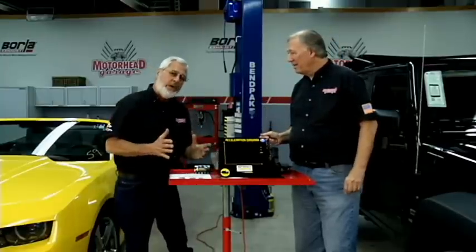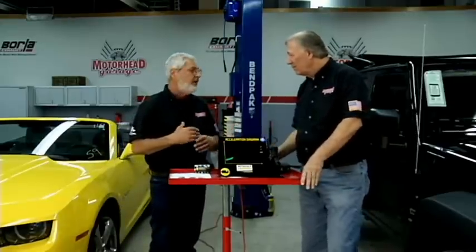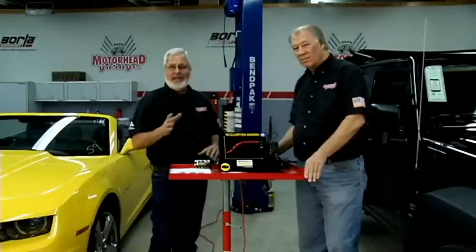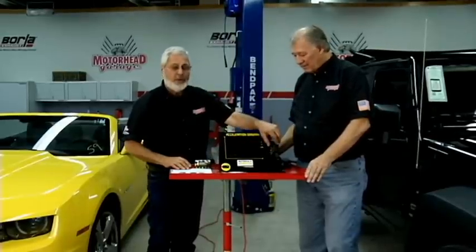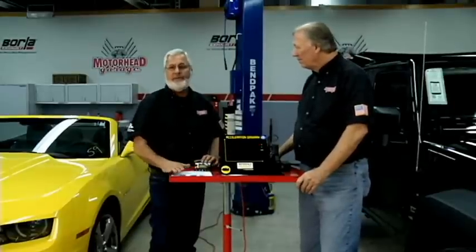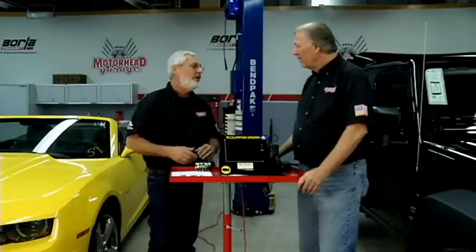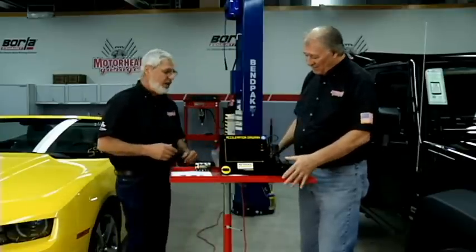Right. But it's a computer controlling how fast that throttle plate opens with a DC motor, an electric bidirectional motor. That gets a signal from the throttle position sensor, which is now mounted on the throttle pedal. You step down on it, and as hard and fast as you push it, it doesn't matter. The computer still does what it wants to do, and here's a great way to show how slow that is.